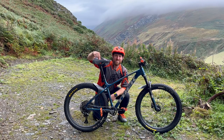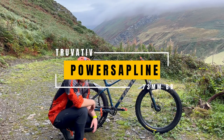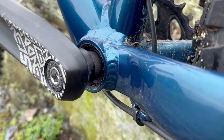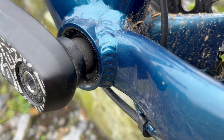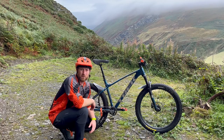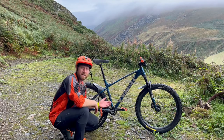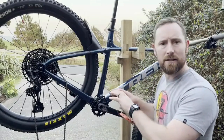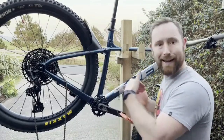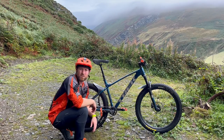Something I had to replace because it broke was the bottom bracket. It comes with a Truvativ Power Spline, 73 millimeter threaded cartridge with a 118 millimeter spindle. You can buy this from most local bike shops or on Amazon. It was actually great fun to replace, and I replaced it like-for-like — the old one served pretty well, and so far so good with the new one.